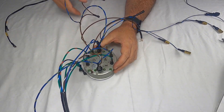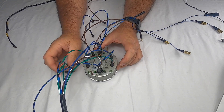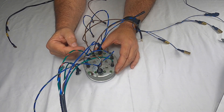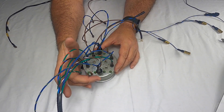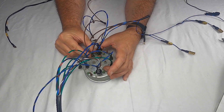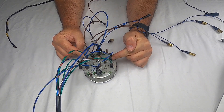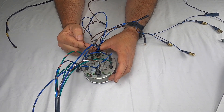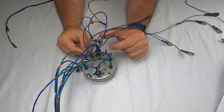To review the oil temp/pressure gauge: oil temp gets green-with-black, oil pressure gets green-with-red — both to their respective G terminals. Charge light gets blue wire; handbrake light gets brown-with-white. Ground goes to either tab. Blue-with-yellow powers the temp positive, pressure positive, the bottom bulb's other spade, the top bulb's other spade, and the dash light bulb.